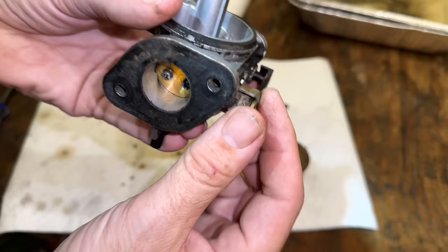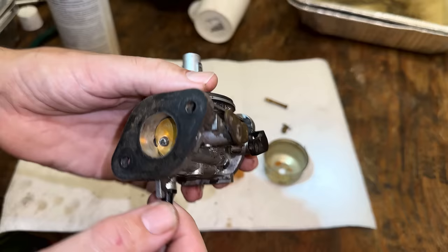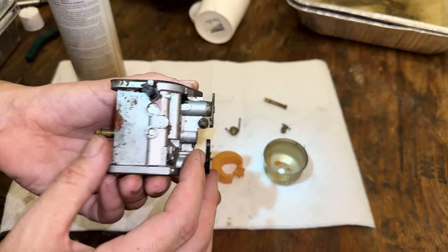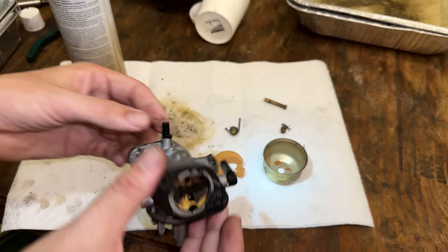That one is in front of the throttle plate. It's always supplying fuel. And that's the one that's adjustable through this needle right here. So what I did was I opened up the needle as far as I could, sprayed some cleaner through it forwards and backwards, and eventually I got a really good flow coming from that. So that, I think, is what was causing the periodic surge. You know, otherwise the carb's not in that bad a shape, at least on the inside.